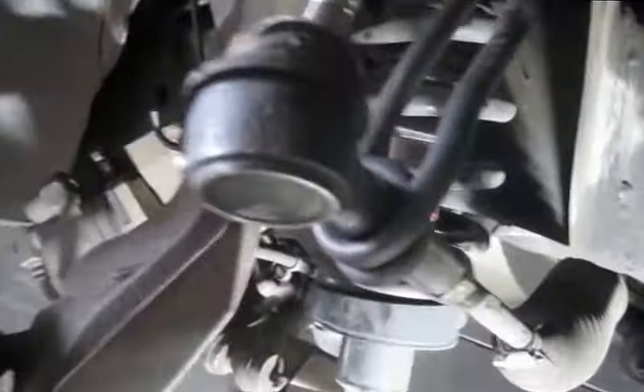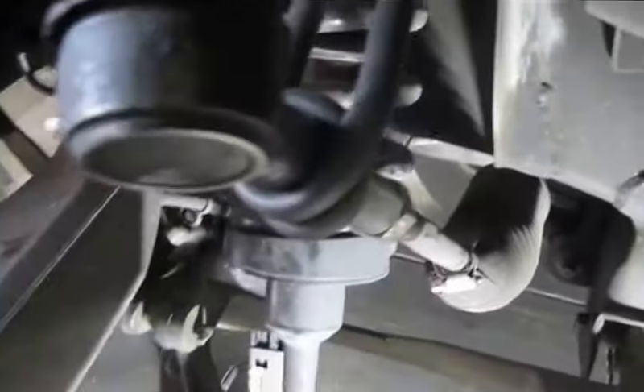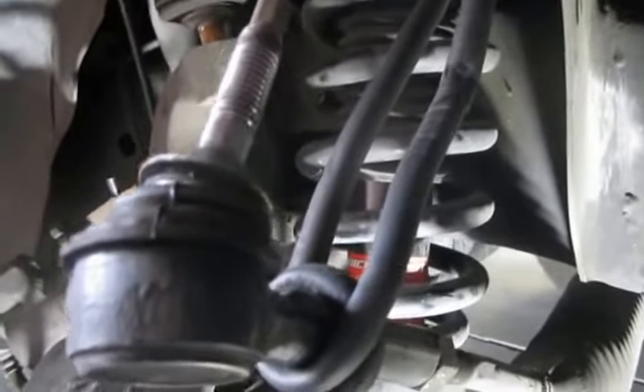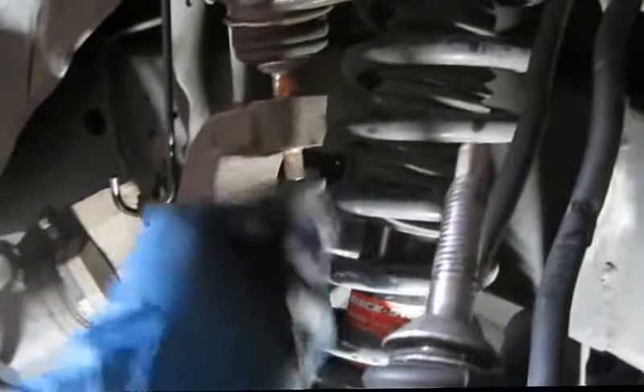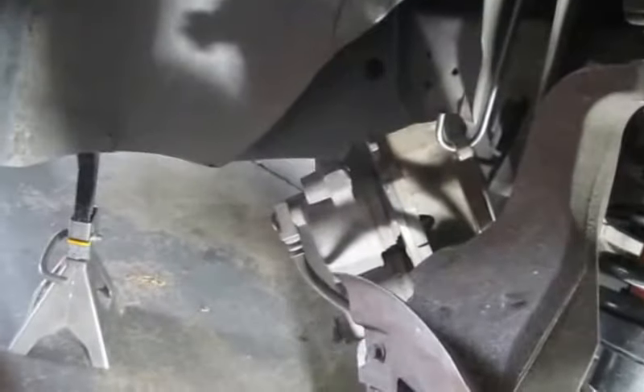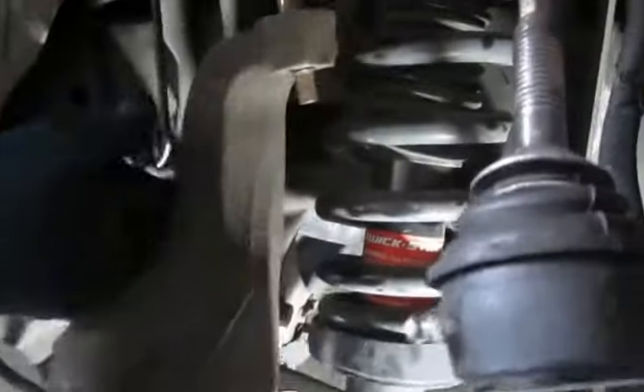Alright, so I got the tire off. I've got it on bungee cords — whatever you want to use — just get it up out of your way and keep the pressure off that joint inside the power steering. So this one almost fell out on me as soon as it came out. These are only about a year old so they're not real old, but it's amazing how much they've already rusted. So I'm just going to tap this guy out. I'd already done it some and it was moving, so I'm going to assume it's going to come out. The brake line hose bracket was held in with a 10mm bolt on the back side.